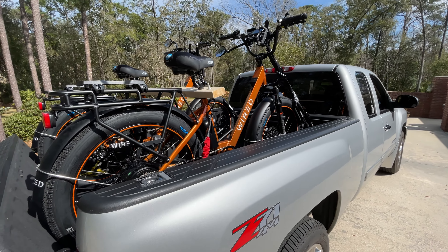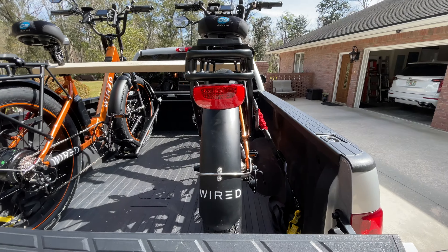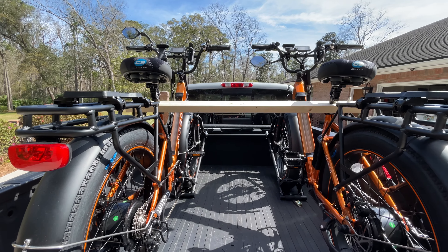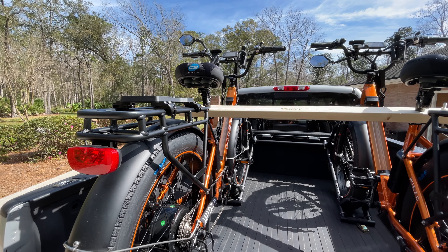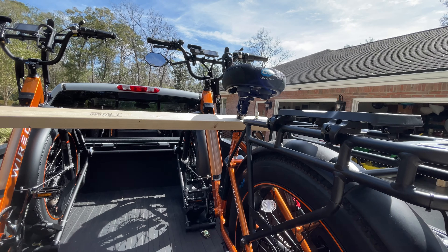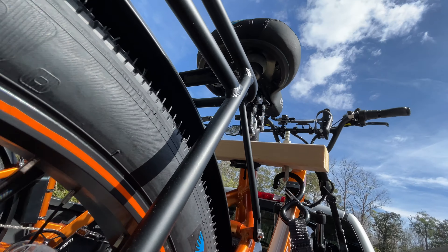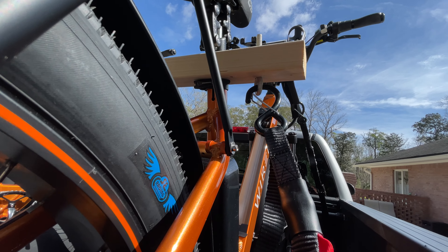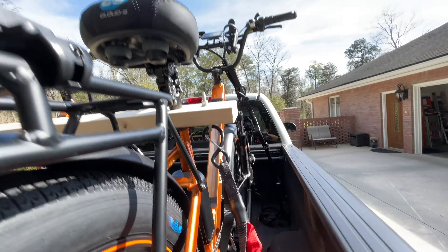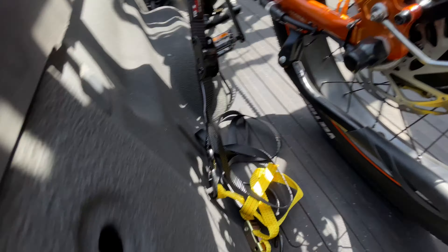What I wanted to do was tie the two bikes together so I could strap on the right side and on the left side, without having any other apparatus between the bikes. So what I did is I took a two by four, drilled holes the diameter of the seat post, and used the seat post and two by four to lock these two bikes together. On the underside of the two by four, I put an eye bolt. I grabbed that eye bolt, brought it down to the bottom right corner of my pickup truck, and on the other side did the same thing — grabbed the eye bolt and tied it down to the bed of the truck.